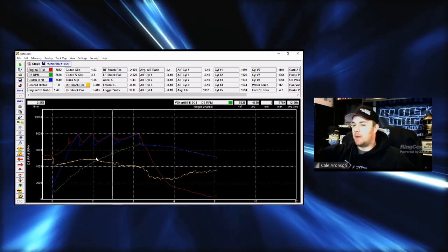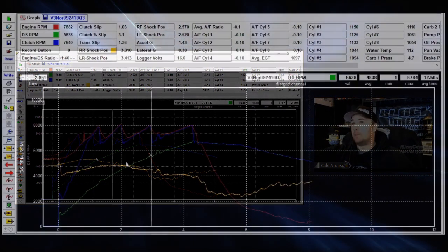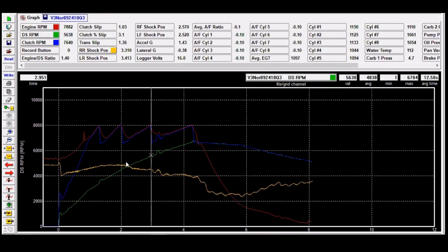We cross the eighth mile with these cars usually somewhere... actually, I said we're way over that, because at the eighth mile we're turning anywhere between 172 to 180 miles an hour, just depending on the air, the conditions, the horsepower you're making, whatever. So by out here, we're getting enough downforce to kind of fix that. But going back, what I want everybody to see is this initial drop. If I were to make that less, it would actually allow the clutch to not have as much load on it. You would get wheel speed easier by basically letting there be less compression.